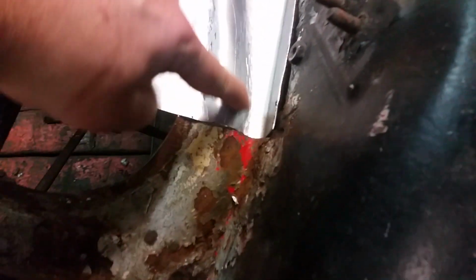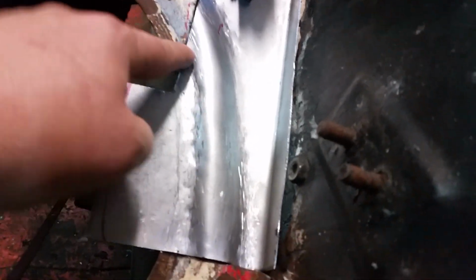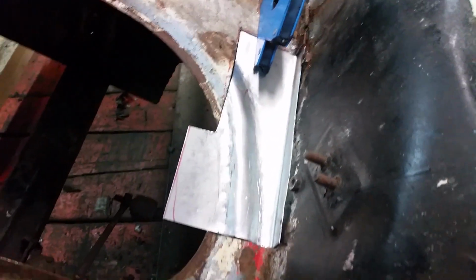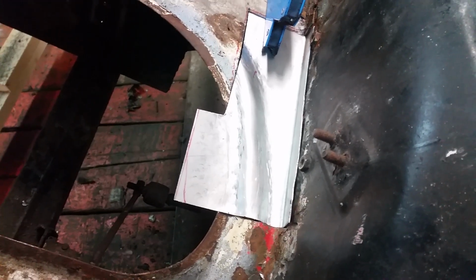So after about 2 hours of cutting and fitting and grinding, it's getting closer. You can see it now fits in the hole. The arch here seems to line up. This is close. This front edge, I need to keep working on that. But I'm happy with the back edge and the fitment all around the cutout. This will be easy to cut off, once it's formed. You just needed to find the points it lines up with. Anyway, about another hour. Gosh, I hope I get it done before lunch.